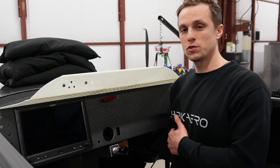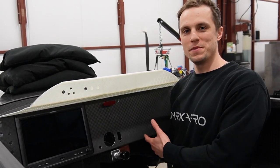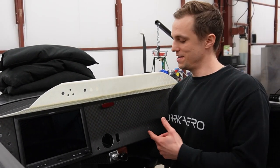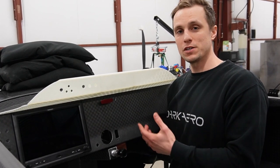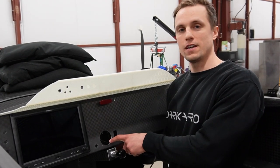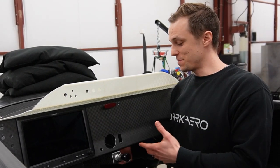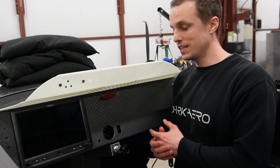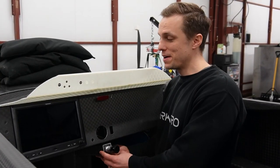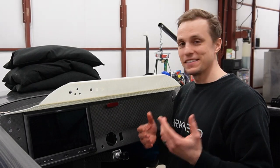The throttle mount is separate from the instrument panel because the cable has stricter routing requirements compared to the wiring that goes into the instrument panel. The UL Power engine only requires a throttle — it doesn't require a mixture, as the mixture is all controlled through the ECUs. One other interesting note is that the prop itself has a controller that's semi-automated. We did some videos on that — I'll leave a link above. Really excited with where this is at. Next steps: get the engine installed, get those components in the mail, get this fully hooked up, and we'll see how that turns out.